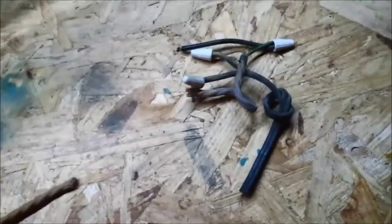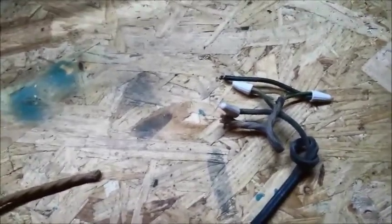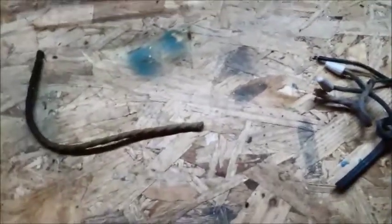And then you can see a piece of the head wire there, the cloth covered cord, and then the rest of this. And that's not just my camera, that literally is black, and that is because they had filled that with so much oil that it actually started to discolor the cloth covered cord, and you do not want that. That's just not a good thing to have. And this is stiff and just really unsafe, not usable, and that's why I replace all of it with modern cloth covered cord, which I believe is double insulated. Not only are each of the conductors insulated, but there's also a single piece of insulation around all 3 conductors before the actual cloth covering.